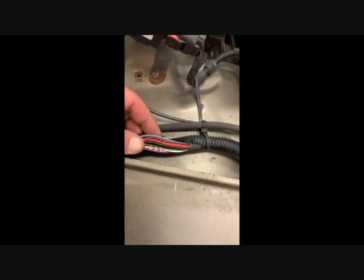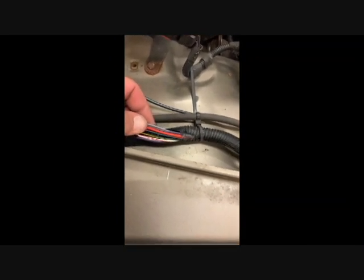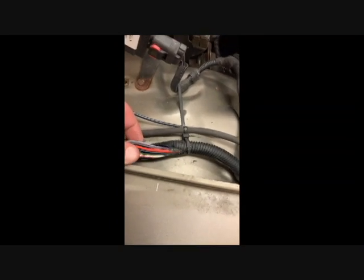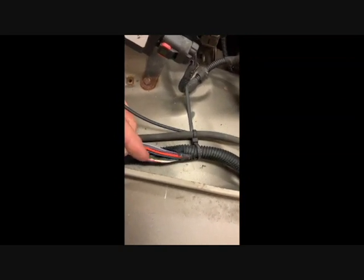Apparently it's black with yellow stripe for the parking lights — I just checked a different schematic. The TJ wire colors change over the years; I know it does for the reverse lights. It also mentioned the headlight switch, so it may have been white with the yellow stripe at the headlight switch. But here's our gray, here's our tan, and here's our black with a yellow stripe — those are my three connections for the parking and turn signals. That's really all I have to hook up under the hood. I have to pick up the reverse signal in the cab on the driver's side rocker panel, but right now I need to make all my connections for the marker and turn signals, and run a wire to the battery to provide power to the relays.